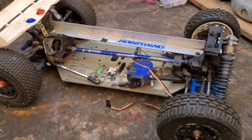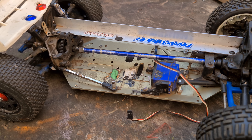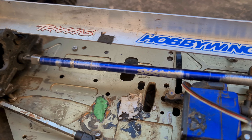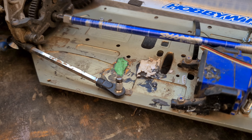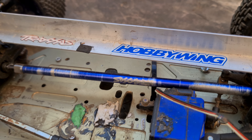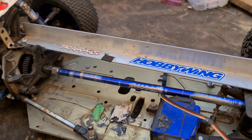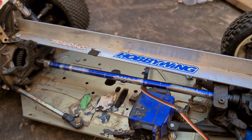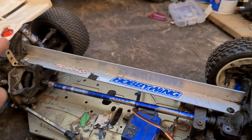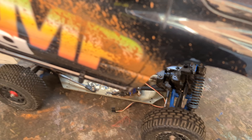We've got the Slash with a 1.8 CNC Durango Dex chassis on there. What we're going to have to do is replace this middle blue shaft here — we need to get an X01 shaft, which has exactly the same spline pattern. I've been told that, thankfully, by Celtic Carbon on Facebook. The X01 shaft is the same but longer.